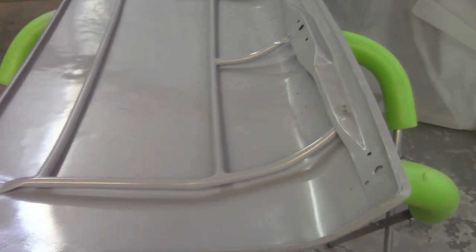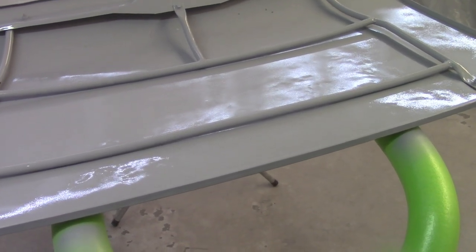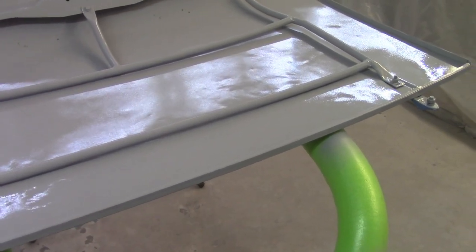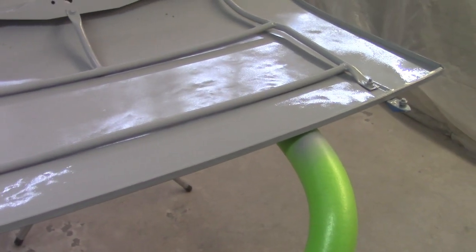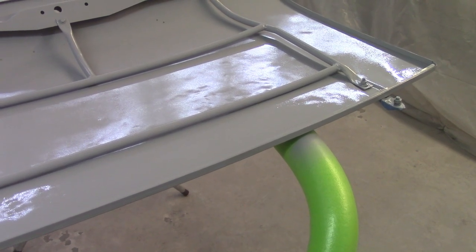Second coat's down, happy with the way it came out. I think it looks better than my recent epoxy jobs. The compressor was fine, paint use was the same. One thing you may have noticed is I started to run out of paint in this area over here — that's just because I had the gun tilted so far forward that there wasn't enough paint in the pot to fill the supply line. Lesson learned. Thanks so much for watching — please leave a comment below. Learned a lot of good stuff in the last two or three days. Thanks to Eric and Robert for the critique on painting technique — that's what started all this. Cheers.